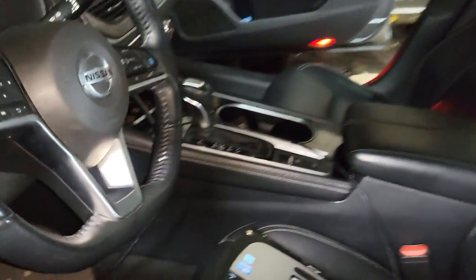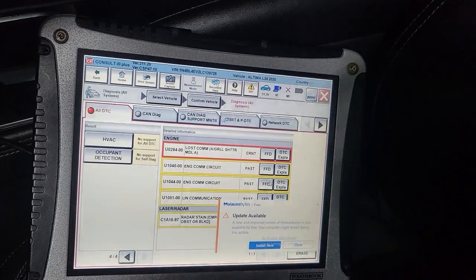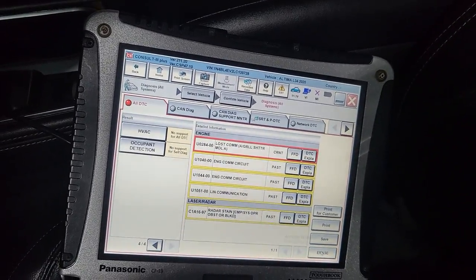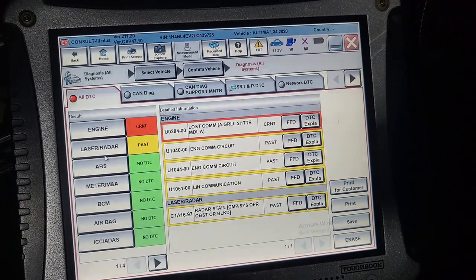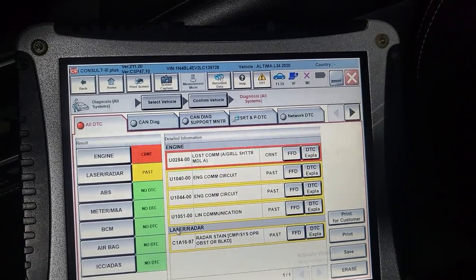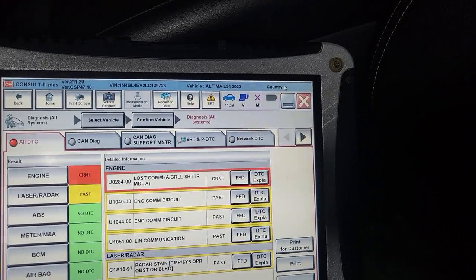That connector is not ideal - I waited for a better one for 10 to 20 days and nothing came. Ignition is on. I'm going to erase the codes - you know how many codes? Four pages of codes. All codes have a reason. But the engine code never goes away so I'm going to erase now. Everything should disappear. Maybe the machine is frozen. Yeah, the tool froze.